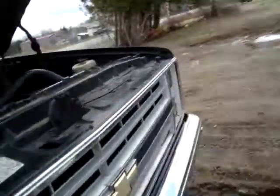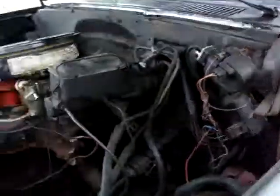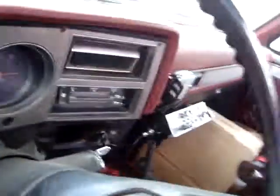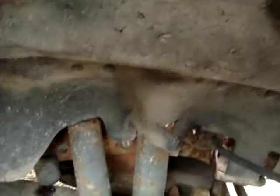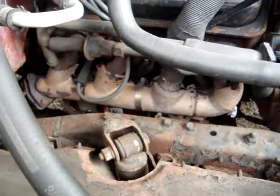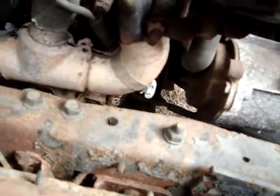As I showed you, we don't have a hydraulic clutch. This one's got a mechanical clutch. So, what we're doing though, we're going to swap a few things. We're going to convert it. This '87's got dual shocks in the front. You can see the mount up here. We're going to convert that dual shock. It's looking to me like most of the holes are all there. I don't think I'm gonna have to add as many holes as I thought I was gonna have to add.